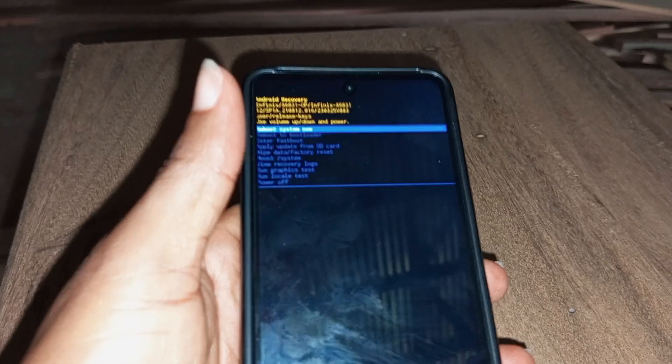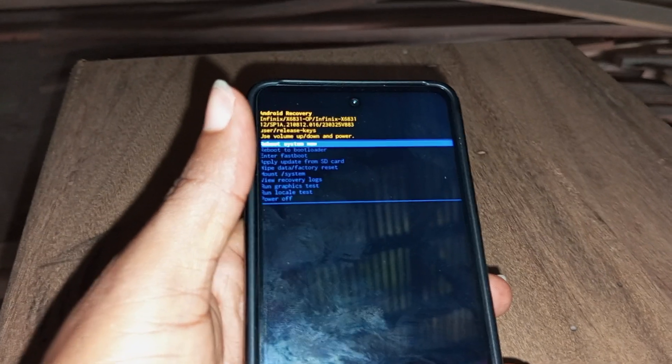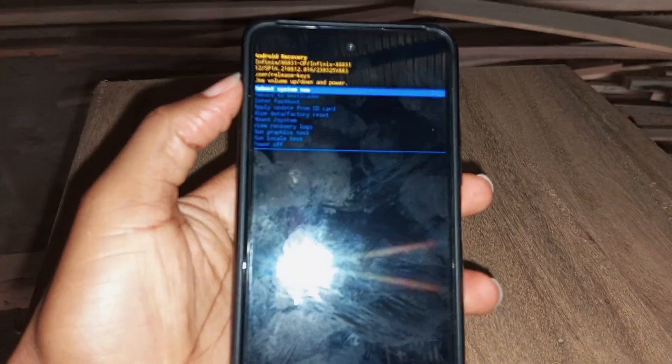As you can see, I tapped the power key and the volume up button for a few seconds and the 'No command' screen is now gone. So what you need to do is press the power key for a few seconds, then tap the volume up button — the 'No command' will exit. We are now in the reset menu.